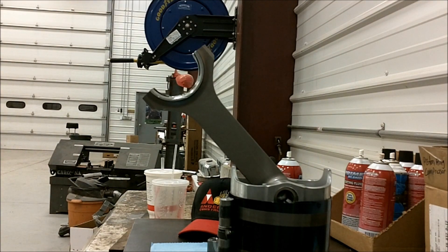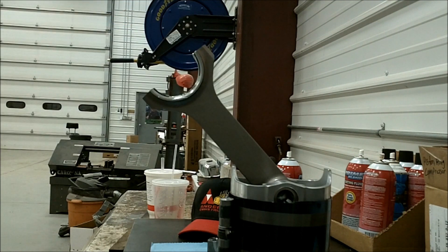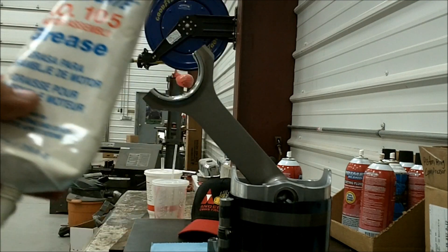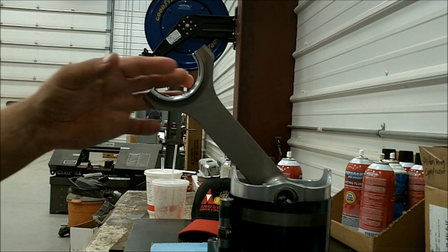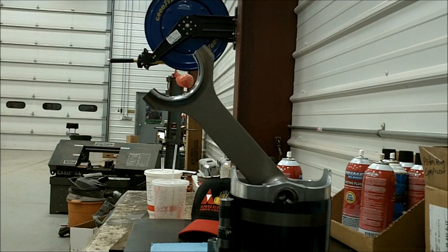This is the hole that's got the sleeve in it. Anyway, the top of the sleeve isn't chamfered as much as the other holes — I'm a little worried about it. I hope everything works out good. I put this Lubri-Plate motor assembly grease — I don't put a lot on the bearings, just a little bit. It'll get oil once she fires up, it just needs a little something to protect it.